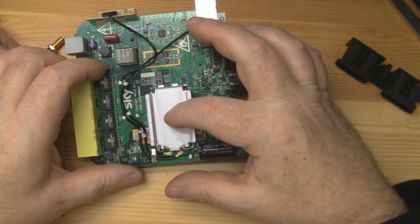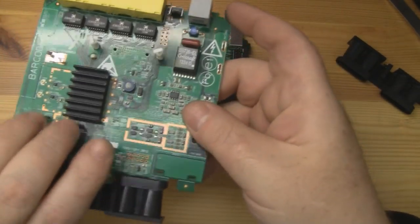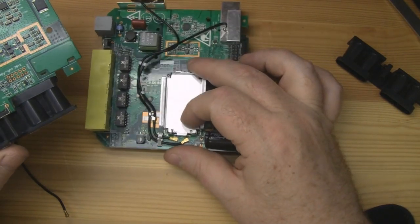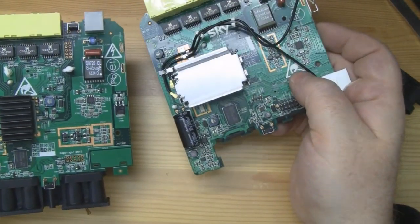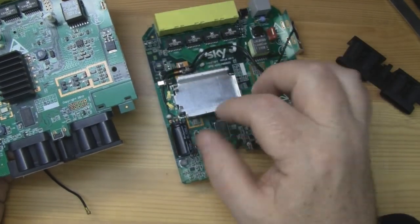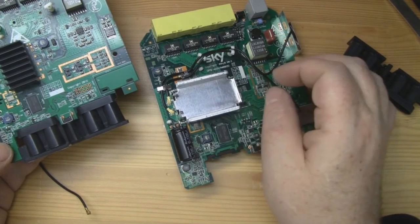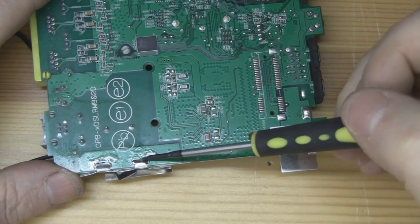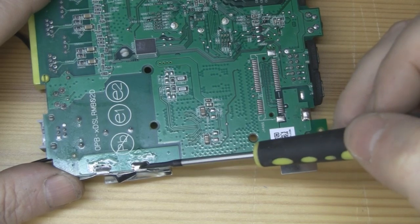The upgraded chip is actually under this big heatsink, and it is quite a large heatsink. If I show you the board from the last router, you've only got a really small heatsink on there. So the chip they've upgraded to is significantly hotter, so it needs that bigger, beefier heatsink. Aside from that chip and that big heatsink, everything else looks to be very similar — no real big changes. There's also this big capacitor on here; I don't know exactly what that's doing, whether the upgraded chip needs it or not. Everything else is virtually the same. I'm getting ready to desolder these antennas away from the main board; once you've desoldered the coax, you can just leave them in situ if you want — they're not going to interfere with anything.